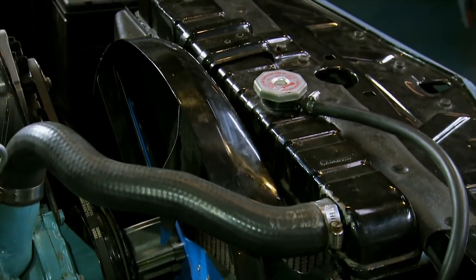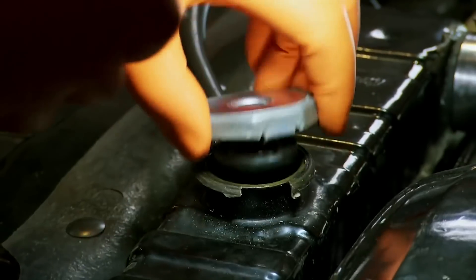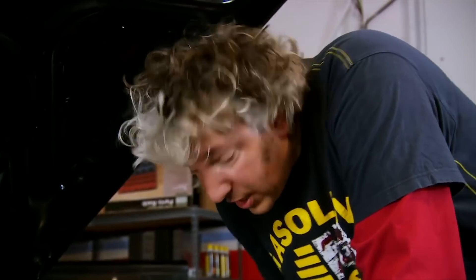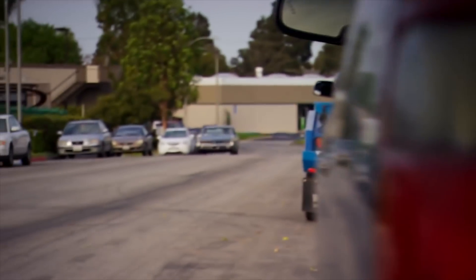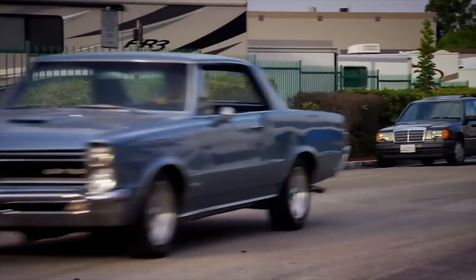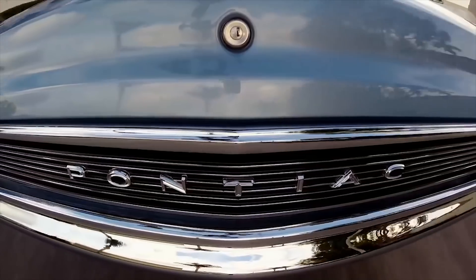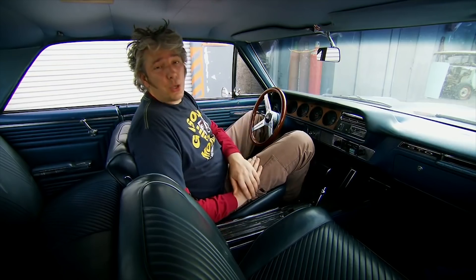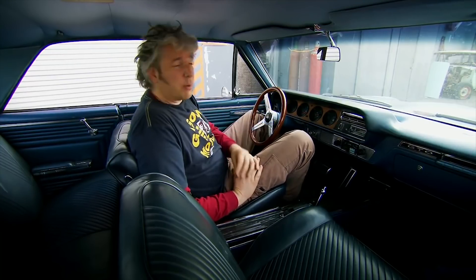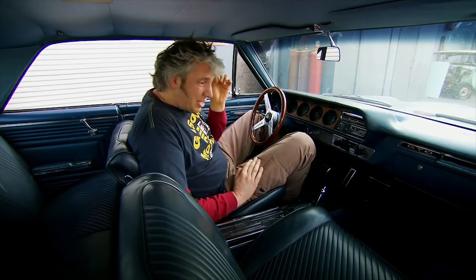The first thing I want to tackle is the GTO's cooling system which despite the previous upgrade isn't up to scratch. It's got to be right - we're hunting big bucks for the GTO and if there is a problem it can seriously affect the life of the engine. After a test drive, at a mixture of speeds the temperature gauge climbs to 230 degrees Fahrenheit and stays there despite the fans being on. It really should be 50 degrees lower. Once it's really warm it takes ages to cool down, and bear in mind once we install the air conditioning it's going to run even hotter still.